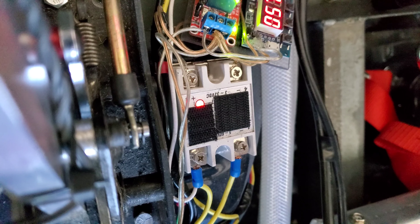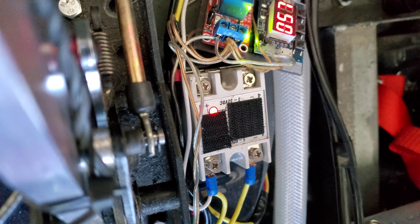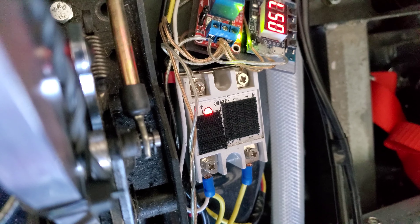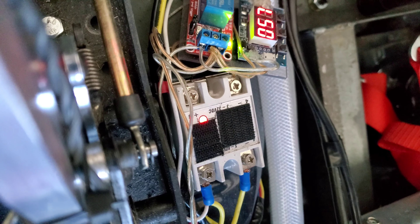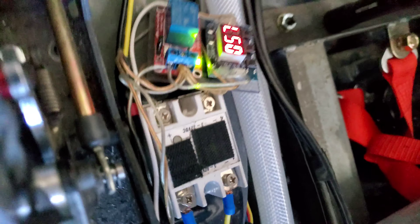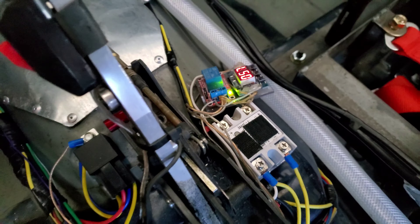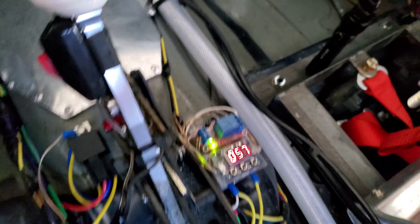You're bumped in — maybe a little more. Every time I let off the bump button, that light goes solid red because the trans brake is still active. So to recap: pull up to pre-stage, hit your trans brake, spool up the motor, you're ready to bump in, let go — light turns off and you're gone. It's that simple. Ten dollars invested into this thing and it works fantastic.